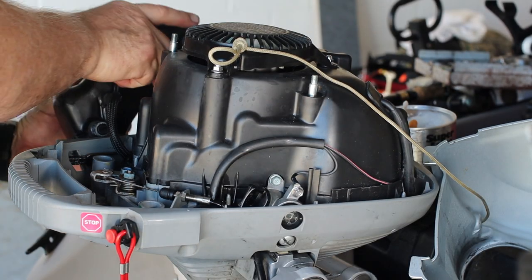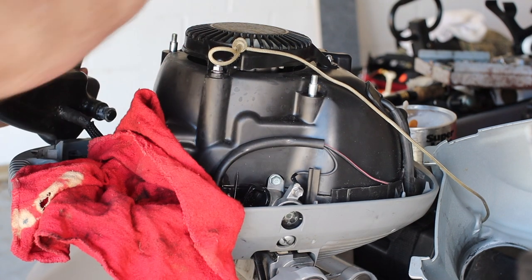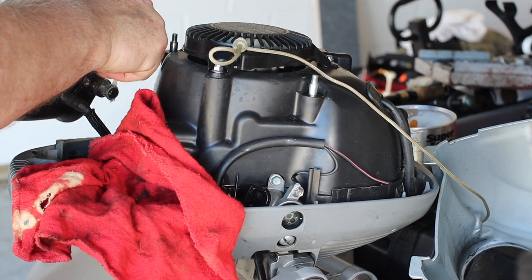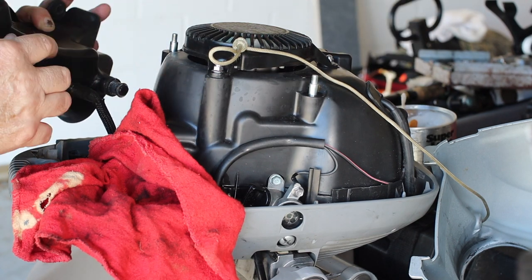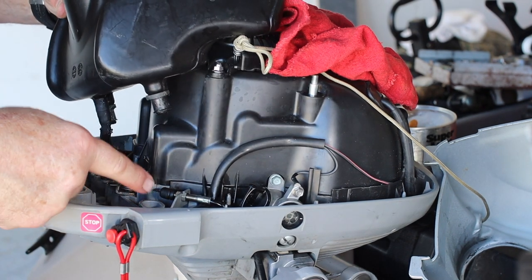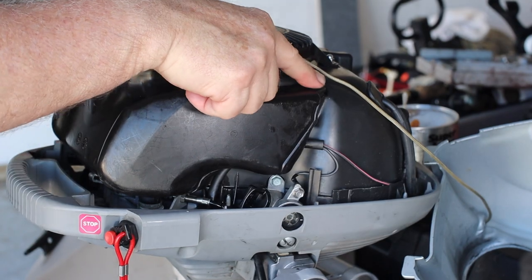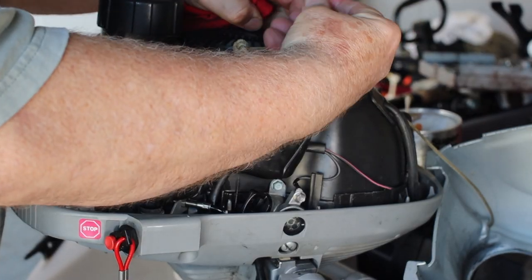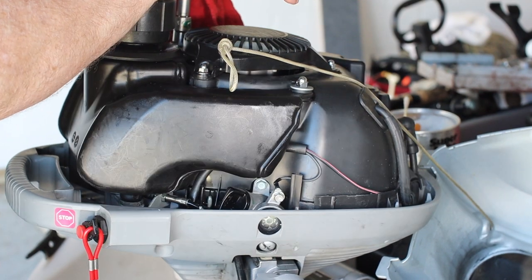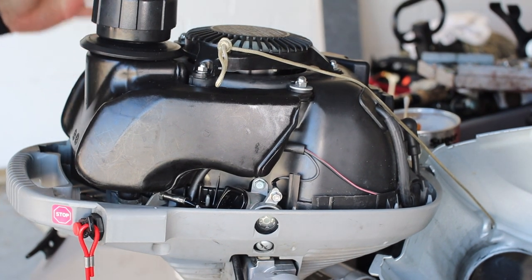Okay, we can put the gas tank back on — I've had it leaning on the edge of the transom. I'm going to put just a little bit of lube around these posts — they seem to stick a little bit when trying to go in and out. Just rub it around with my fingers and wipe off the excess. These two alignment pins have to go in these two spots and the fuel hose goes on the outside. Make sure it's in those holes and it goes over the two bolts that are sticking up. Tighten them — remember, this is mostly plastic so small metal components could easily break.